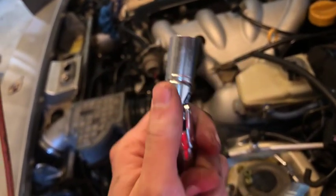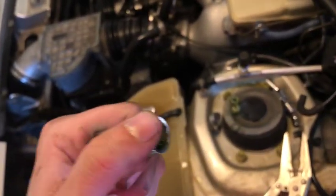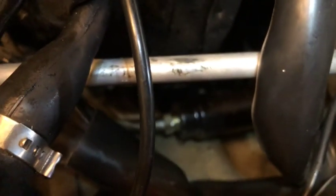Now I'll bolt down the other two bolts back there — same thing: the angled universal drive adapter. A little bit more grease on it will hold the bolts in place. We are in place: the new line is back on the new cylinder, bolts are snug. I didn't find a torque setting — Clark's Garage just says tighten it down — so I used the old German torque setting of 'guten tight.' Just snug it down with a little extra; you don't want to overdo it, you can always tighten more later.